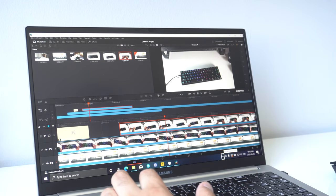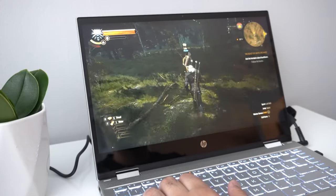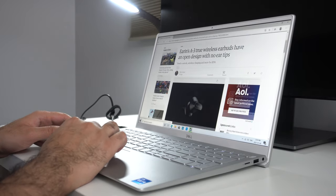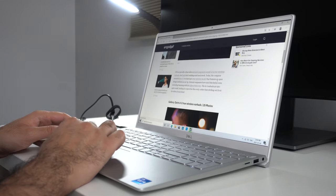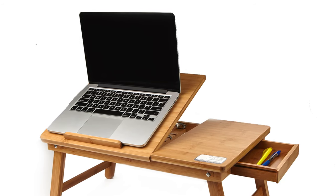When your laptop gets too hot, it starts scaling back its performance to make sure components don't get damaged by overheating and are actually able to function rather than just dying out. One of the best ways to make sure your laptop gets plenty of air is to use it on a nice flat surface — an ideal example would be a work desk like the one behind me. If you do want to use your laptop on your lap, you can use a flat book or a tray between your thighs and the laptop. In all cases, avoid any surface that's going to block these vents.